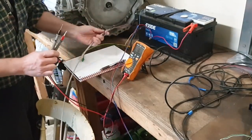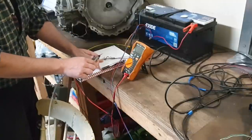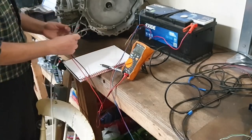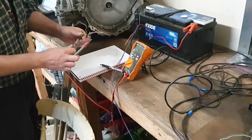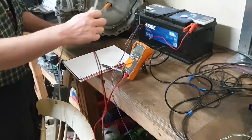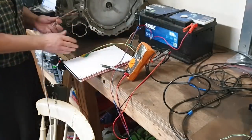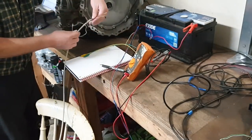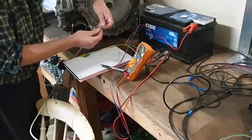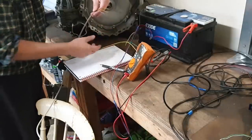So we've got two multimeter probes. We just verify firstly that they're indeed giving us pretty much close to 0 ohms. And for the sake of simplicity, I'm just going to use two little clip leads onto them so that I can clip on. So what we're going to do is determine which of these wires is a pair. So we should have three pairs.